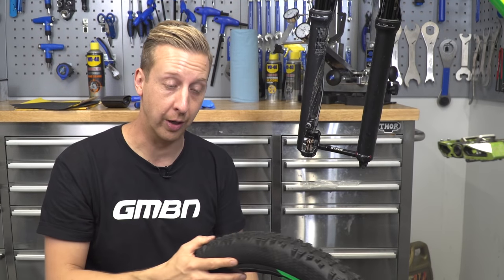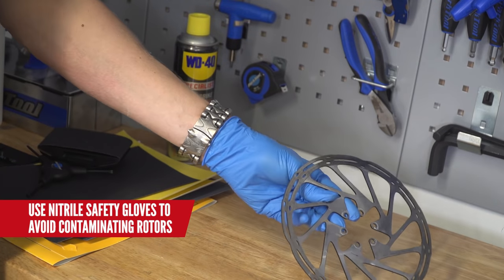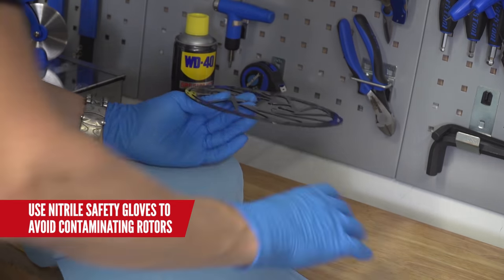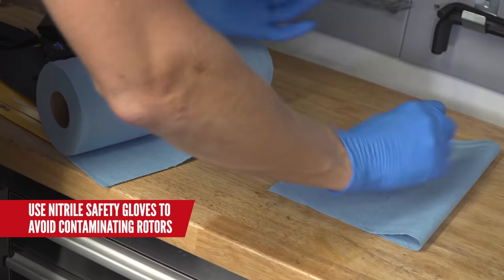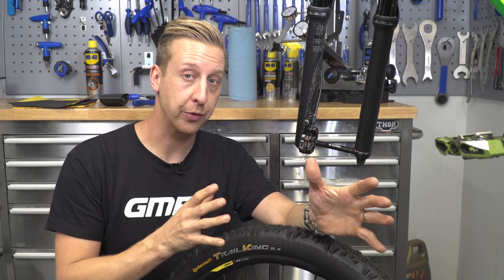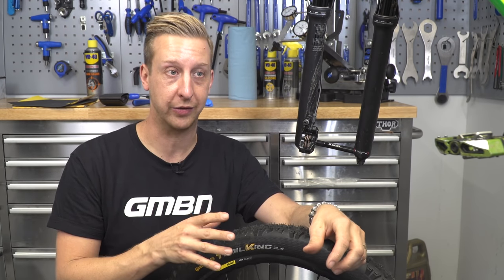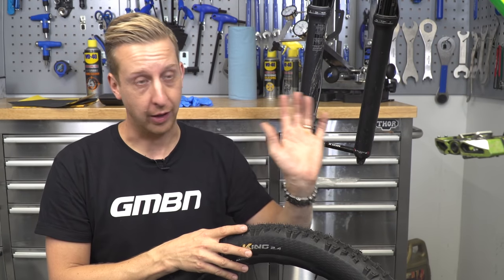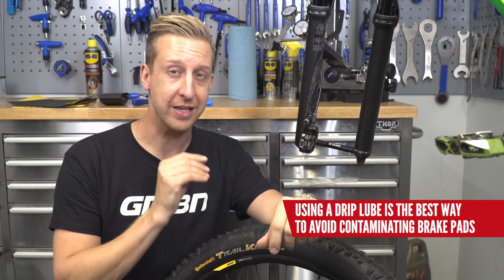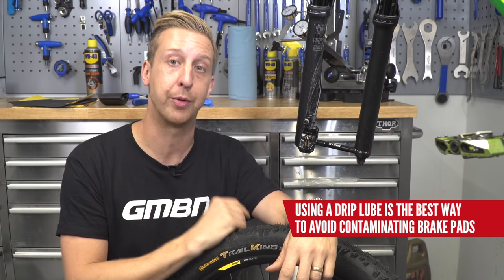The next one is a bit of an unusual one, but it actually affects a lot of people — and it's handling the disc rotors themselves with your bare hands. You could have touched oily stuff on your bike and transferred it over, or you could just have slightly oily skin, which does actually have quite an effect on squealing of brake pads. The final thing to take into account is if you use any kind of spray lubricant or water displacer on your bike. Even on breezy days, that mist can transfer all the way to your disc rotors. Be super vigilant, because the tiniest bit of that oil mist can really ruin your brake pads and rotors.